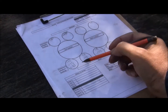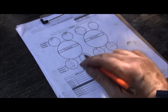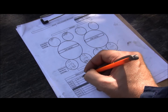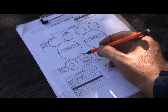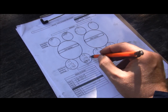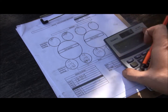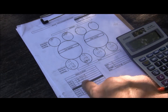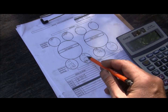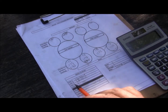Now, if you can see on the bottom of this we've got shims to order. You've got your inlets and your exhaust, so everything stays nice and neat and you can work with what you need. Inlet 1 was at 0.16 — that's good. Inlet 2 at 0.18 — that's good, I'm not changing that. Inlet 3, we have 0.23. The medium we want to be at is 0.175, and that shim we just measured is 2.80. If you look at the other video, the equation I ran shows A equals B minus C plus D. A is the shim we want to order. B is the clearance. C is the medium. D is the existing. B minus C, then add that to D gives you A.